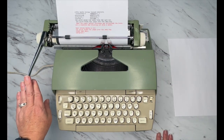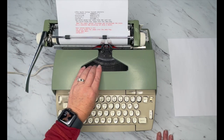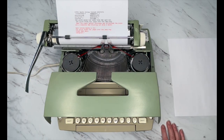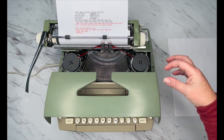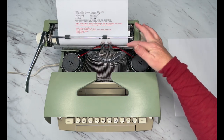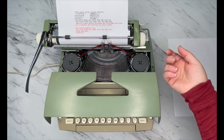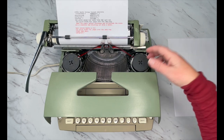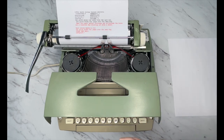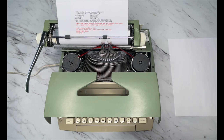I'm going to move this carriage all the way to the left because I want to open this top, and I need to move this return handle out of the way so it doesn't scratch the top. So now I'm going to pull it forward. Inside you'll see the ribbon spool. This typewriter will use a universal ribbon — make sure if you are purchasing a universal ribbon that it's a two-inch spool with a half-inch ribbon. You can find them on our website at jotandtittletypewriters.com. We have a really inexpensive plastic option we buy in bulk, or we have ribbons that we hand roll here in our shop where you get twice as much ink ribbon — so it's going to last you a whole lot longer — and you get to choose plastic or metal spools.